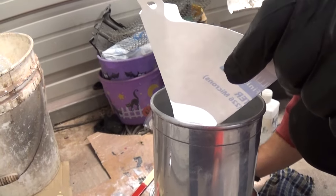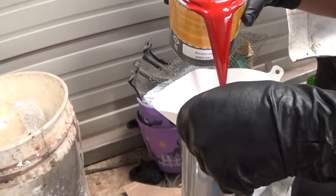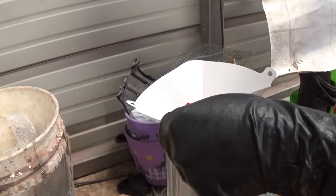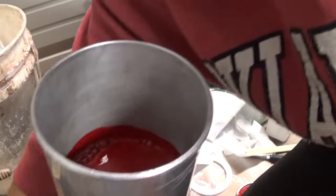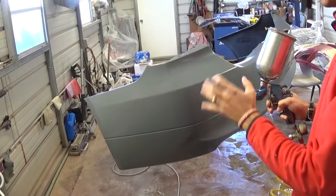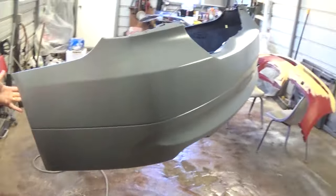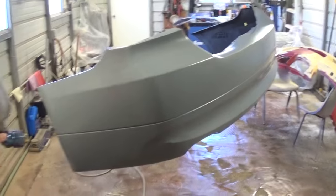What I usually do — I prefer to have about one-third to one-half of the gun full. Not over one-half because it gets too heavy, but if it's too empty you might run low on a few spots when you tilt the gun. I usually start with about half a gun on something big. It's important that the first coat is very thin, because otherwise it will run. You need to get all the edges, especially around the fenders and wheel wells — that's a common spot that people miss.